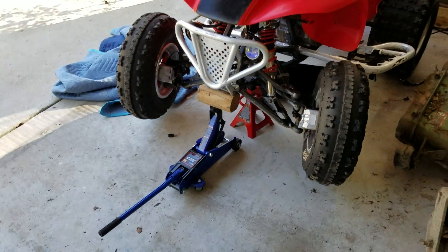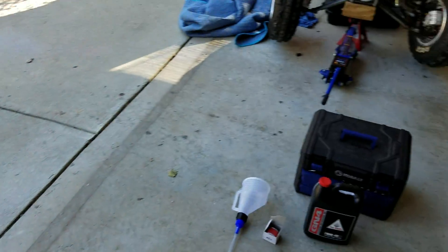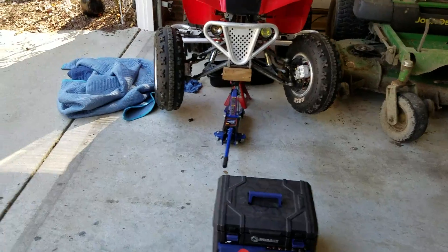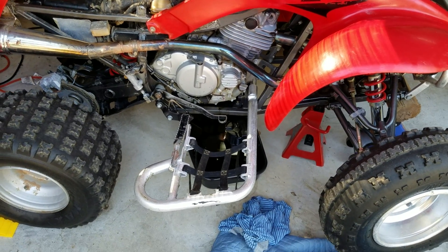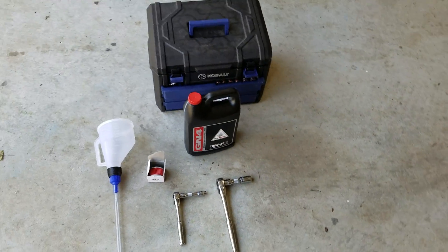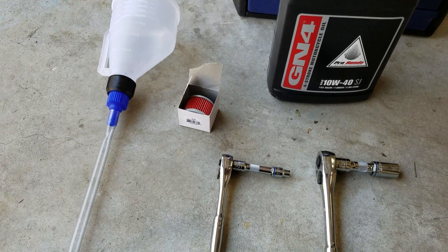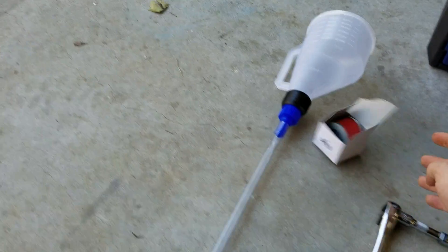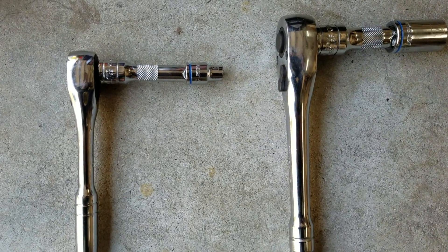The tools you're going to need — my GoPro is charging so I figured I'd shoot this on my phone. You're going to need a jack, a jack stand to safely lift up the ATV, and an oil pan down there. You're also going to want a long funnel, some 10W40 GN4 oil off Amazon, a 300EX Amazon oil filter, and a 17mm socket with extension and an 8mm socket with extension — you should be able to see those labeled there.